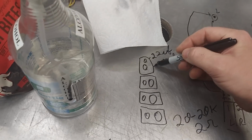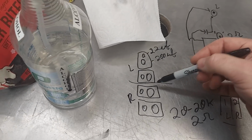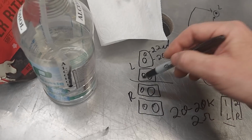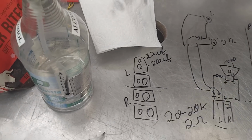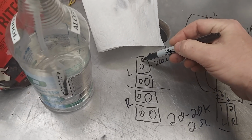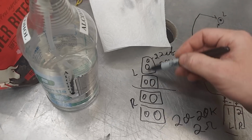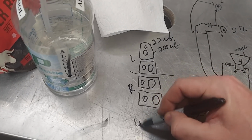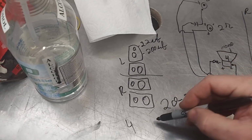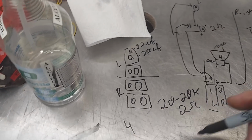So, these were meant for left, and then this is right. And these are all 4 ohm, so you'd only see 2 ohm per channel. Well, Andrew got confused. He didn't know. He's like, well, Patrick, you're running all these, and I think he ran all these tweeters series parallel to get 4 ohm and then put them on 1 channel, and then ran all these together in series. He added a terminal. He did all kinds of dumb stuff. I was like, what are you doing?